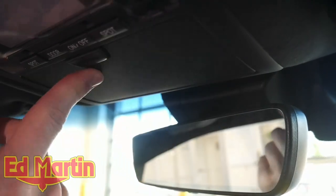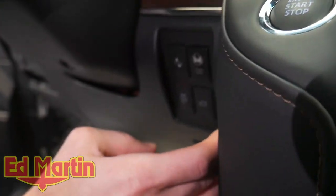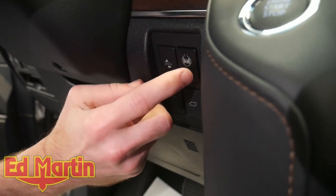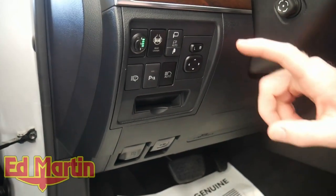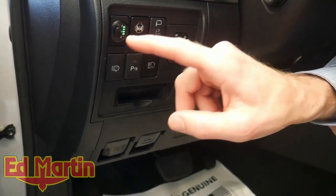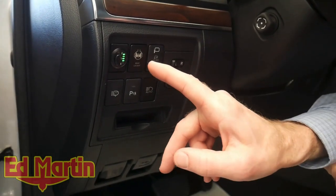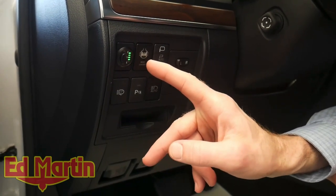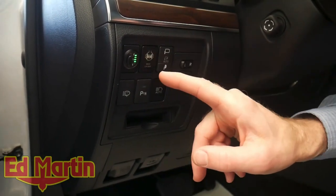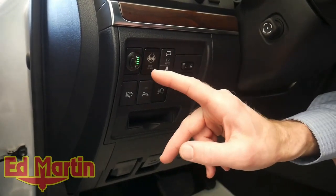So those are our lights. While we're talking about switches, let's mention a couple others. On the right side of the steering column, Toyota gives you one extra blank, and what we've done is added a rear locker enable button. On the left side of the steering column, we have our two factory blanks — one is for your rear locker. The enable switch is on the right side, so in order for this button to work you have to trigger the enable button on the opposite side. Both buttons would have to be pressed, just so you don't accidentally enable your rear locker inadvertently.